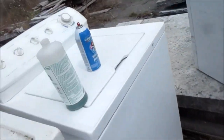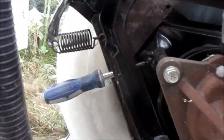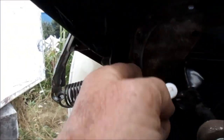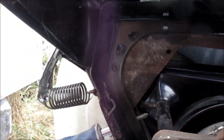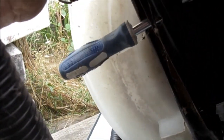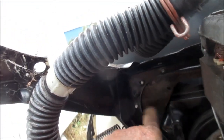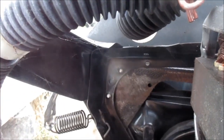We're going to paint that up — I've already primed it, should be sanded a little more but we'll get these things going. Here are the little slides — this is what the drum rides on. You have to push the old ones out, stick something in there and pry it apart, then put the new ones in. They go over here, you have to line up the two little dowels into the two little holes so it sits nice and tight. They're called snubbers or tub glides.